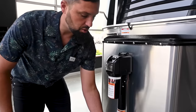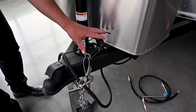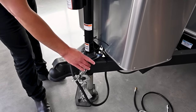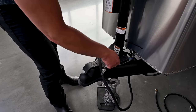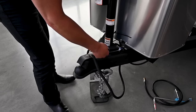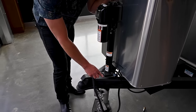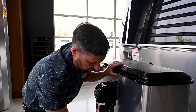There's a trailer brake-away cable here. The trailer battery system must be active for the brakes to work when disconnected from the tow vehicle. In an emergency where the trailer came disconnected, it would pull the plunger out and activate the trailer brakes so the trailer could stop on its own. If you pull this out and leave it out, it will rapidly drain your trailer batteries — it's only meant for emergency use.